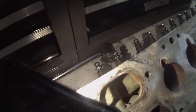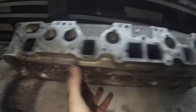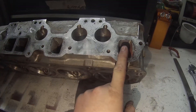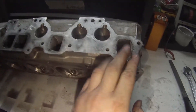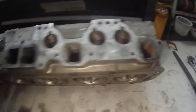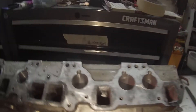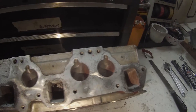You can get a look down in there and the coolant flows around the combustion chamber. The problem with these cylinder heads is the way they flow — cylinders five and six run hot. They run way hotter than the rest, and on high horsepower engines or turbocharged engines that becomes a problem. You can detonate and blow piston rings on five and six probably once a year if you're not very good at tuning.